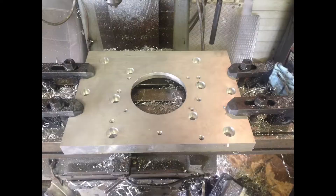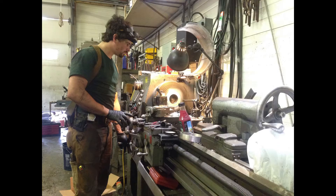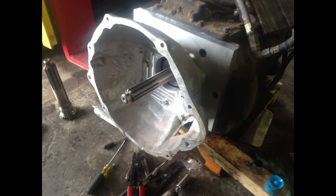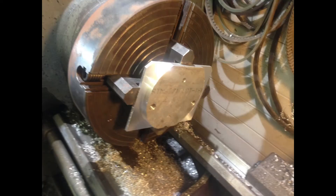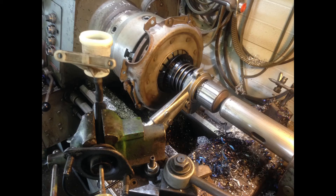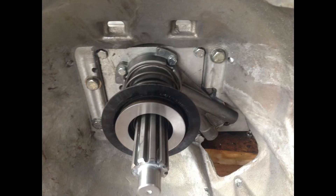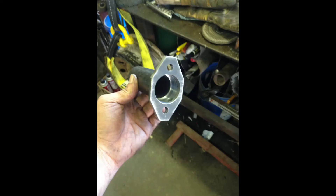So I decided to build my own adapter plate using the NV4500 bell housing. I had to figure out how to hook up the hydraulic clutch, so I found a concentric throwout bearing used in some Mercedes and some Freightliners. They were really expensive — around $700 — but there was a surplus company down in Philadelphia that had them for under $100 a piece, so I bought one of those. I got a 1¾-inch input shaft for the transmission, swapped out the input shaft, and made this adapter to fit that throwout bearing. Here I am testing it on a random clutch I had laying around, making sure I had enough flow. I ended up needing to get a Wilwood brake cylinder — the largest diameter one I could find — to make it work, and I had to cut these out a little bit to make the shaft fit through. This is the adapter for the Wilwood master cylinder.